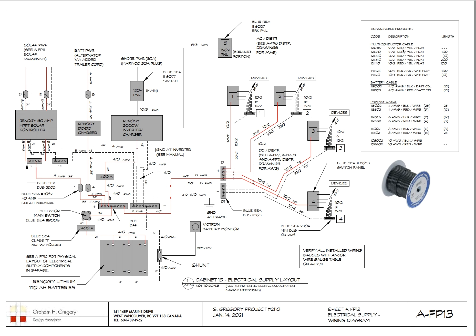We did a breakdown of the footage we need for each gauge of wire — kind of like a takeoff based on this diagram. Four-aught (4/0) is one gauge of American Wire Gauge (AWG). The gauge of wire is dependent on the current it draws. The bigger wire is back near the battery and it gets smaller as it goes out toward the appliances.